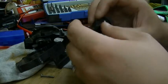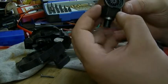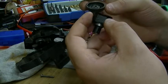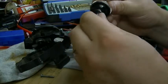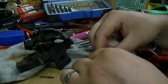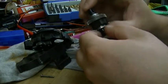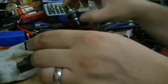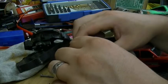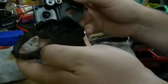When you've got it about right, you should get just a hair bit of grittiness — due to the design of the gears, there should be just a fine little bit of grittiness and it should be about perfect. If you go any tighter, it'll feel like it's locked up and extremely tight. Too loose, and you'll be able to wiggle the two drives back and forth without any consequence. There shouldn't be any play between the out drives. Too loose is better than too tight, but too tight will give you obvious issues. Too loose is okay as long as you're not getting audible clicking.